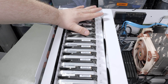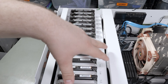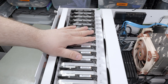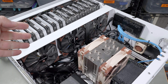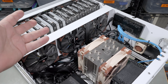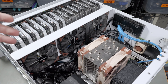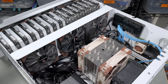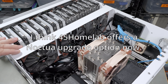The main array of 14TB drives mirrors over to the 18TB backup array continuously. I also replicate select data to a six-bay NAS at my dad's place for off-site backup. The only other nitpick I have is the stock fans being three-pin running at 100% all the time. In a real server that's perfectly normal, but since the HL15 is geared toward home use it would make sense to offer a fan speed control option - most home lab users want it quieter. The Noctua fans work really well for that, though you're paying for six of them.